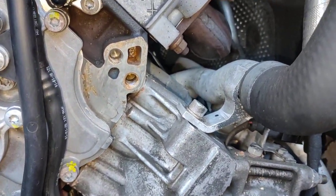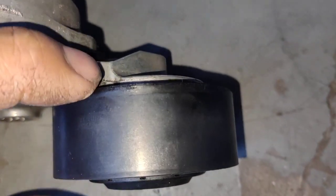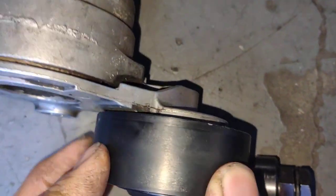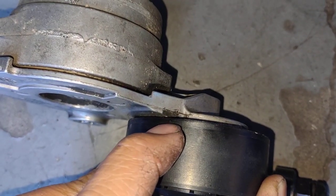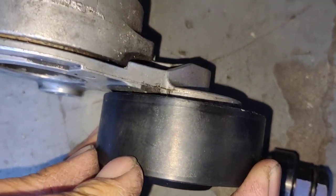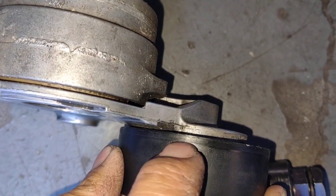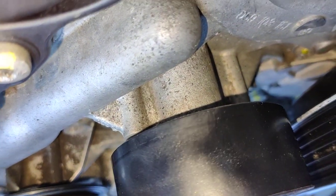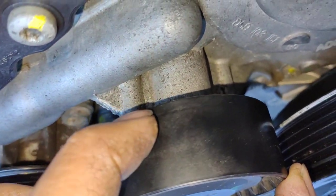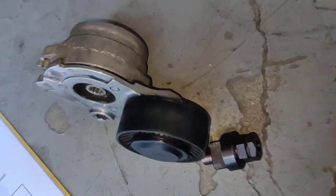So that's the actual washer there. You've got to put a washer, and I can tell you right now — if you look at the belt, the belt goes on this pulley here, this is the tensioner. The belt has never ever sat properly on the tensioner. The belt's been sitting between there and there, never sitting flush across this tensioner. That's why you've got to put a washer to bring this part forward more. The washer is exactly the same diameter as from there to there. You can see the mark on this as well — because the belt is always sitting between there and there. The belt should be sitting between there and there. That's one reason why the belt is coming off.